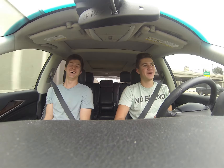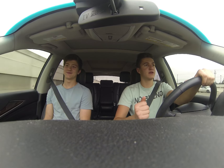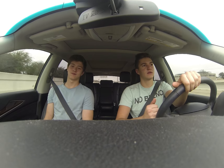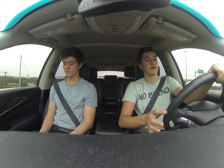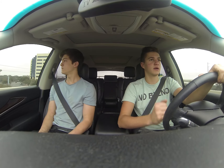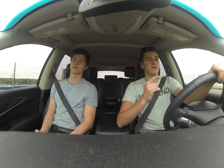What's going on guys? I Drive It All here. I'm with Tana. Today we're working on the '63 Chevy he picked up the other day — a '63 with a 283 V8 in it. We're on our way to go get an NV3500 for it, so it's a 5-speed which will really help with miles per gallon. And we pulled the 283 out of it and we're going to get a 350 to drop in.